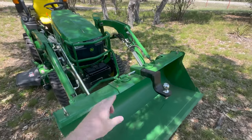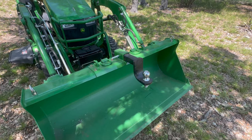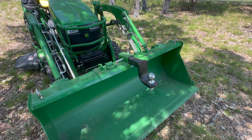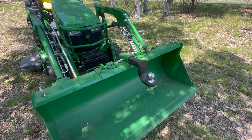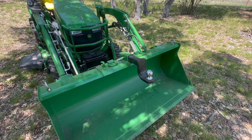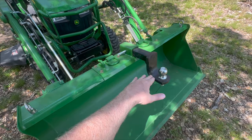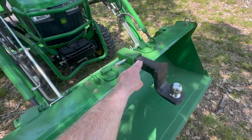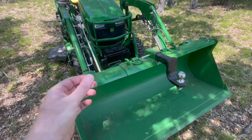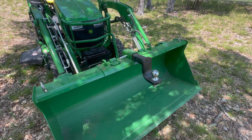The first thing I added was this two-inch receiver. It's got the D-rings and chain hooks. I believe that came from JU Fabworks, and it fit and installed easy. I've got a video on that if you'd like to take a look. One thing I did notice after moving my 16-foot cattle trailer and my brother's ski boat is this does flex and bounce if you get a lot of leverage on the end. I'm sure if you choke up on it, it will help a lot. On this thinner metal right here, don't expect the world out of it when you lift.